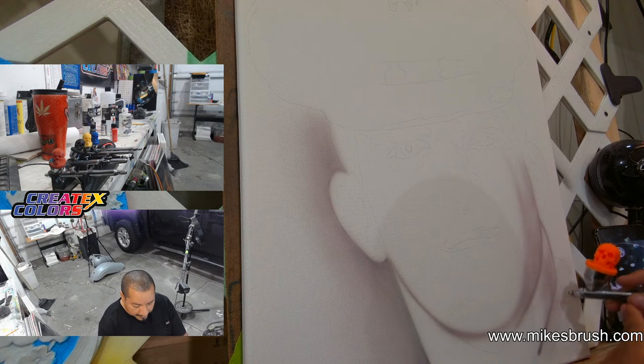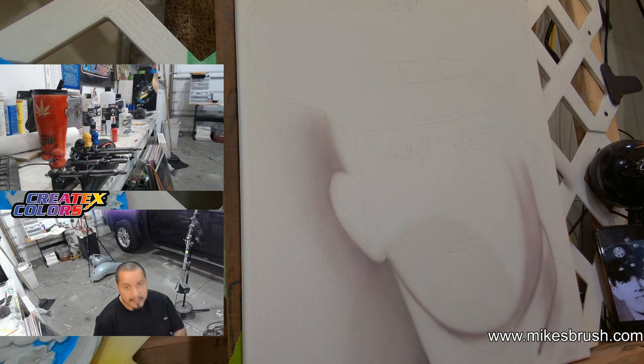Some plastic is made to be slick, made so stuff doesn't stick. Other plastic is just made to hold a mold, and that plastic can be painted, like vehicle plastics and stuff like that. Most of the time, I just degrease it and clean it really well before I lay down any paint, and that usually helps a lot.